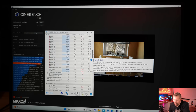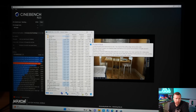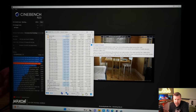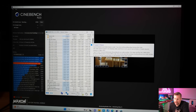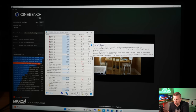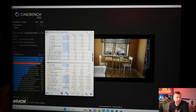The system is out of the box configured pretty well to give you good performance without giving you crazy temperatures. Now, since it's, I believe, an unlocked CPU, Lenovo lets you tweak it with Intel XTU and other control software like ThrottleStop. That's going to let us undervolt this thing, raise the long power limits. It'll let us push the performance of the CPU up to maximum and really give us the ultimate level of performance control that advanced users will love to see.